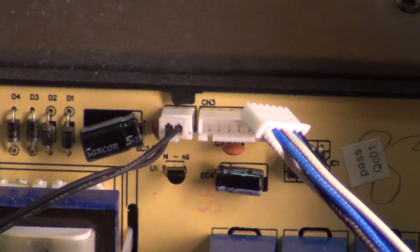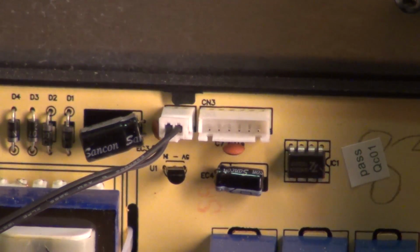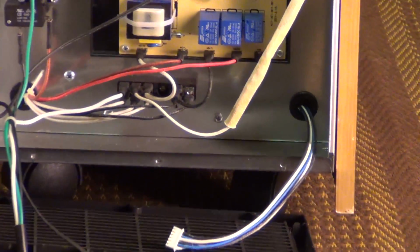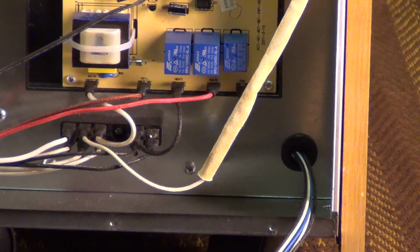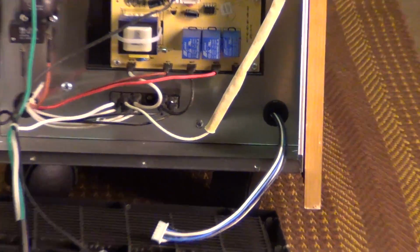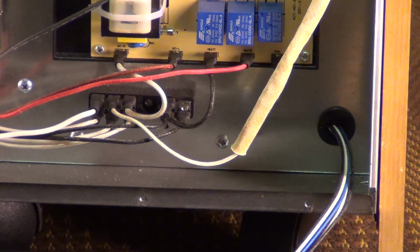just pull it out. Now I've got to get rid of this tie wrap here. I'm going to cut it. Okay, so this is free. I don't know if you can see it, but I'm going to zoom in. There's a grommet on the bottom of this wire that I just disconnected, and I'm going to remove that now. Pull this out.